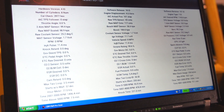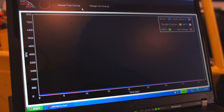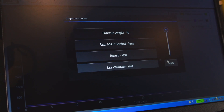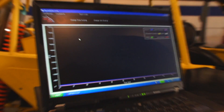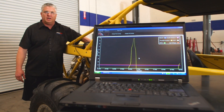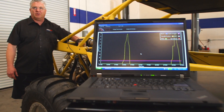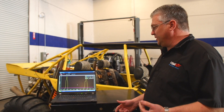If we'd like, we can go over to logging here. The logging gives you different scaling — we can change the unit scaling and the time. We want to go over here to TPS, which is going to allow the throttle position to be shown on the screen with RPM. As I sweep the throttle position up and down on the car, it's logging the percentage of throttle, allowing you to check and verify if your throttle position sensor is good, bad, defective, or something other than that.